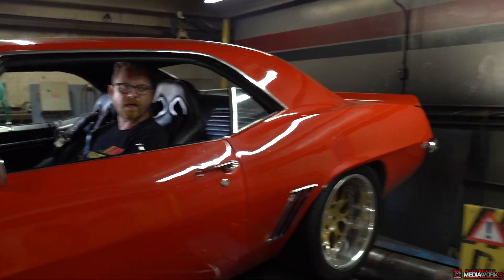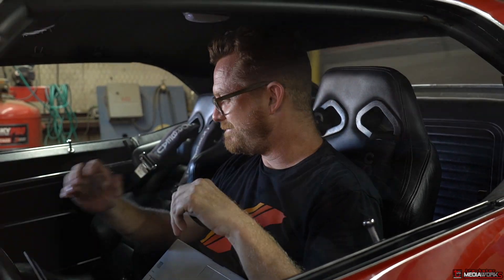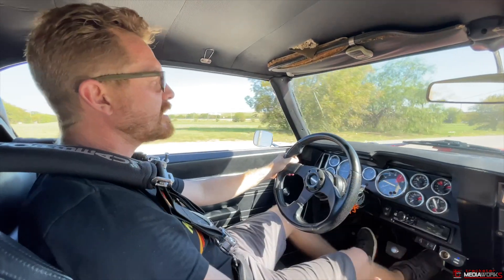High number — I think we'll probably call it there. The AFR looks perfect now, exactly as targeted. The timing is safe and comfortable — it's not conservative low, it's right in the meat of where it should be. I think that's going to do it. He should be extremely happy with the improvements. I think he was driving it around with like 350 horsepower, so I believe a hundred-plus horsepower was added — especially at the very top end where that catch can was creating a big vacuum leak and lull in power. Time for a street drive. I can tell you it's already driving better because it was stalling out left and right when it rolled up, and now it's driving very normal.